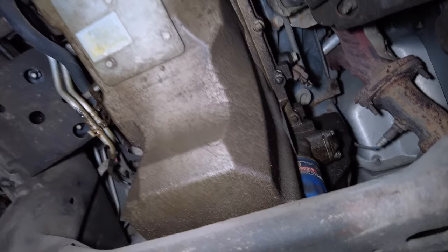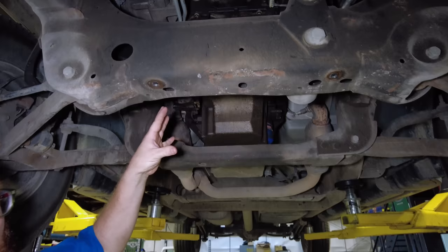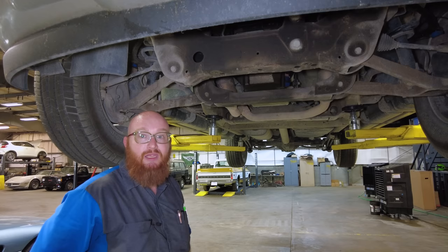If it's a four-wheel drive, another common leak point would be differential seals on either side — I've replaced so many sets. The CV shaft comes down, you pop out the flanges, and put the new seals in. Sometimes they can be done in the vehicle. If it's a four-wheel drive, check the differential — I can almost promise you it's probably leaking.